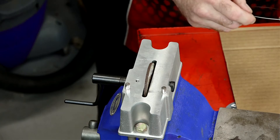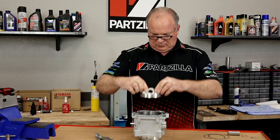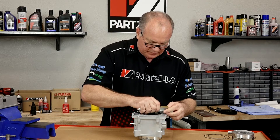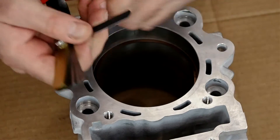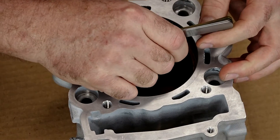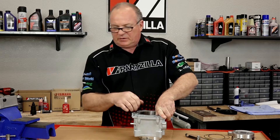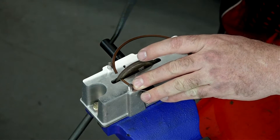We'll clean up that edge, wipe it off, and pop it in the cylinder to see where we are. We're right at 13 before — 13 should have no trouble getting in there, and it doesn't. 14 can go, so we're getting close. 15 gets stopped, but it can go — it's a little tight. So we're zeroing it in. Let's pop it back out, put it back on the grinder. I'm thinking 20 or 30 more turns and we should be in the ballpark.